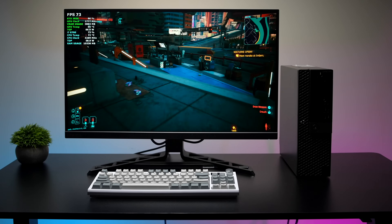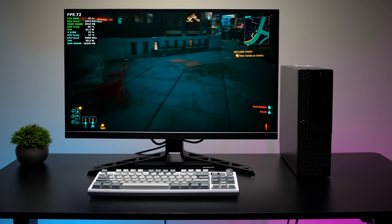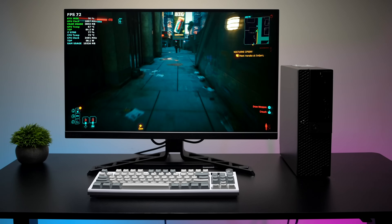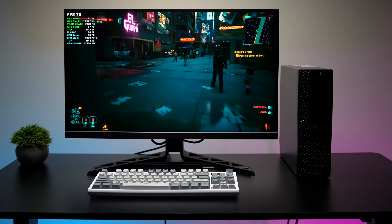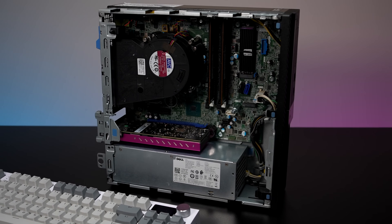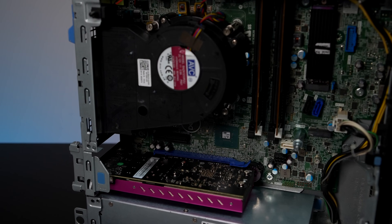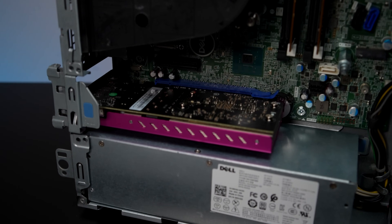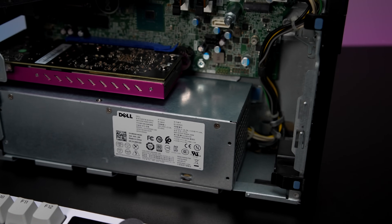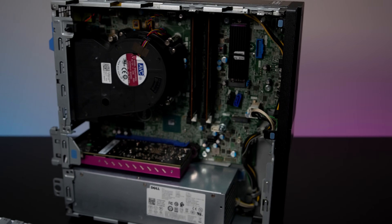Overall for what we have here it's not a bad little system given the price paid. If you wanted to go a bit bigger instead of small form factor you could probably get out a bit cheaper — you can find a used RTX 3050 for cheaper or even go with something like an RTX 3060, and it would fit inside one of these Optiplexes in the mini tower or mid tower. For 1080p it's doing way better than I thought it would. If you're interested in putting something like this together I'll leave links in the description, and if you run across any newer low profile single slot GPUs that outperform the RTX 3050 for around the same price, let me know in the comments below. That's it for this one — thanks for watching.